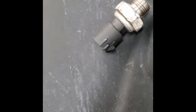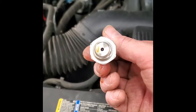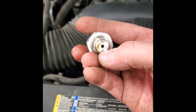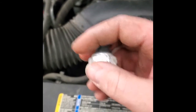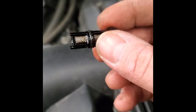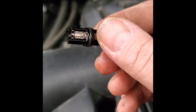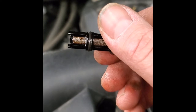That is the oil pressure sending unit. It sits right inside the intake with an electrical connection that plugs in, and the oil pressure forces itself against it, reading millivoltage based on how much the little plunger inside gets pushed up into the sensor. The issue with these LC9 5.3-liter engines common in 2008 through 2012 GM pickup trucks is that particulate builds up on this screen.